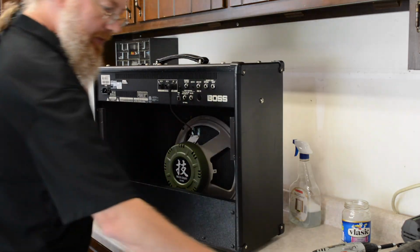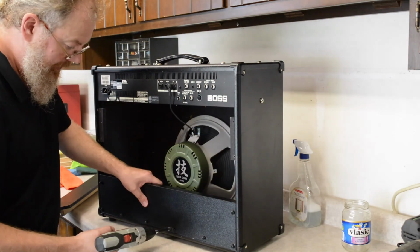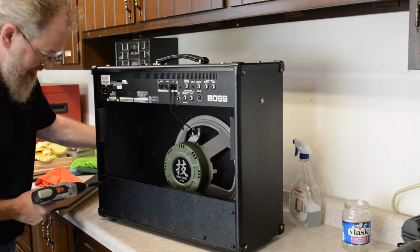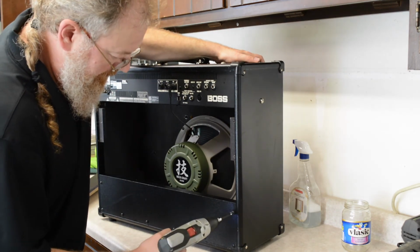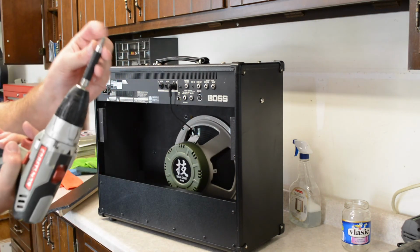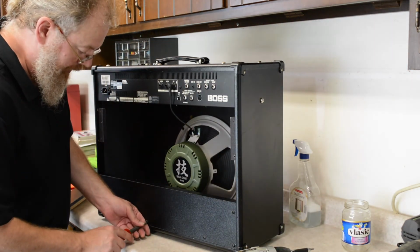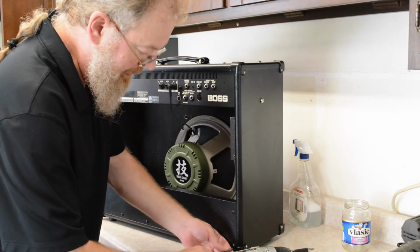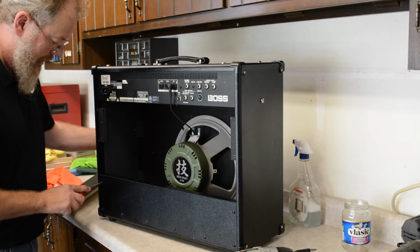Man, they use a lot of screws. You can hear that. You don't hear my bit hopping around inside the screw. I use a sharp bit so that I don't round over the ledges of the Phillips screws. It drives me nuts when people let power drills bounce in the screw heads. You're just tearing the screw heads apart. Set the torque low enough where it don't bounce. Use the torque features of your drill, people.